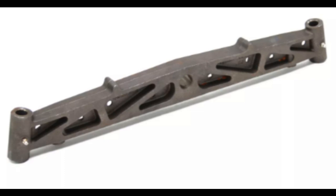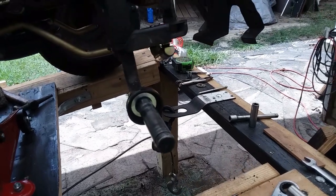This video is part two in a series dealing with looseness or slop in the front ends of Craftsman and Husqvarna garden tractor mowers. What you're looking at here is the pivoting cast-iron front axle. This axle is very strong, but the only part you can get for it is the pivoting bushing — you cannot order the bushings for the kingpins at the two ends. Since you can't get them, there are options, and I'm going to show you one I've used many times, something I learned where parts were hard to come by and you had to use your ingenuity.